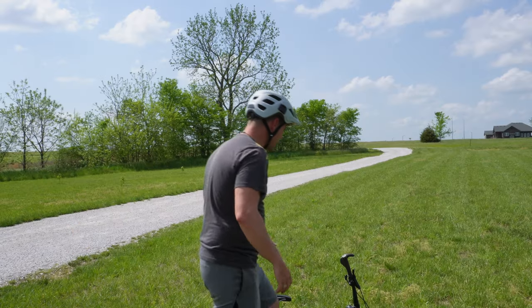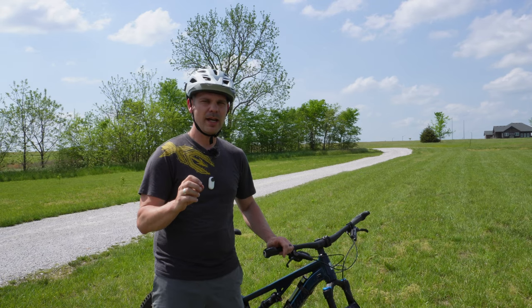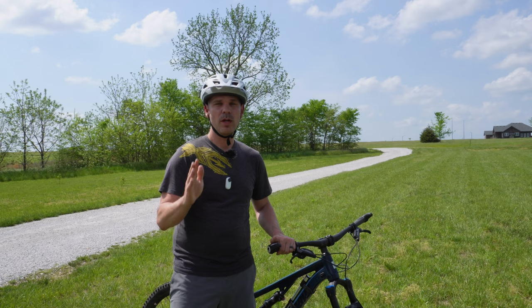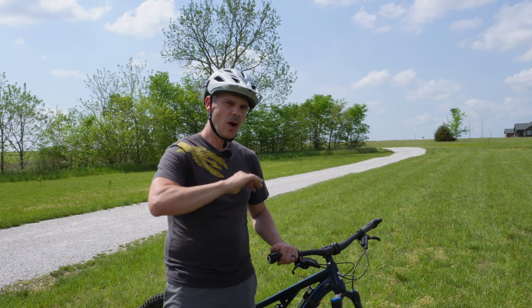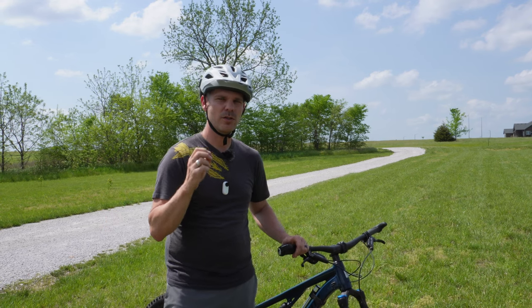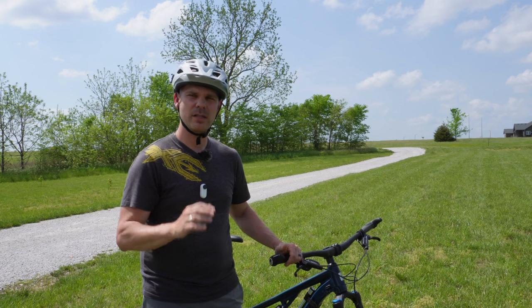Now that we're out here with our bike and we are ready to bed our brakes in, what is the bed-in process? What exactly is it doing? On your brake rotors there are going to be fine little bitty divots that you can't really see or feel with your hand. Basically what you want to do is put some of that brand new compound from your brake pads onto that rotor and make it nice and smooth. The trick is to not slam on your brakes and lock up your wheel, because you don't want to apply too much compound all to one spot. If you do, you could have squeaking and squealing and all kinds of weird noises coming from your brakes.